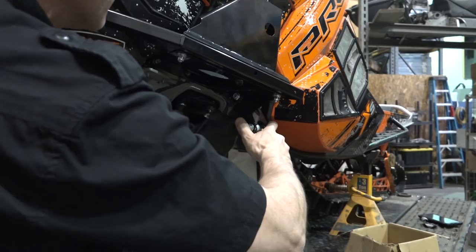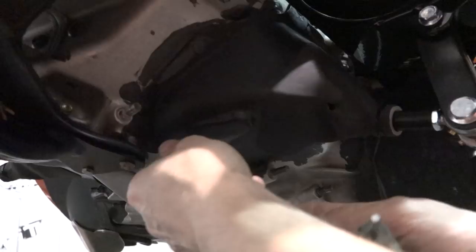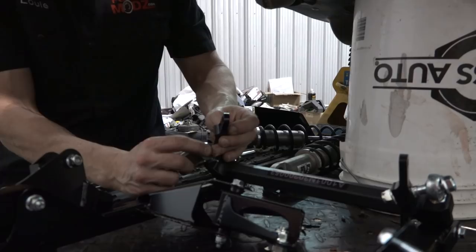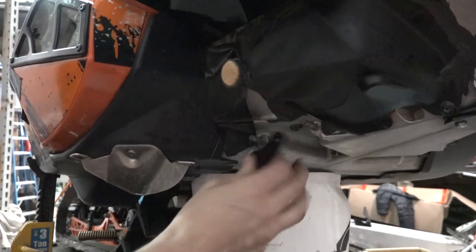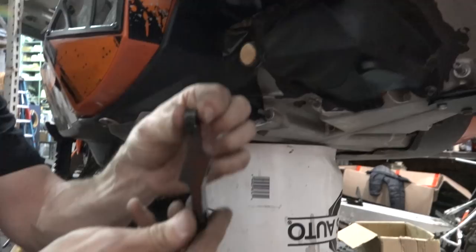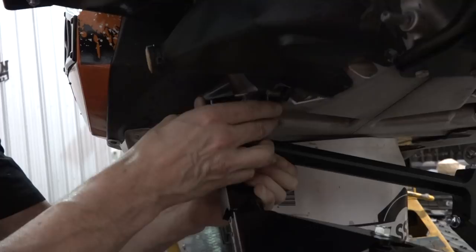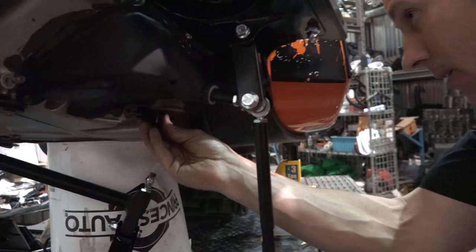That moves freely. That's done up. Now we can buckle this baby up right here. There we go. We'll pop these babies out, but when you're doing this, just watch this little spacer thing here. Don't lose that. And these go on like that, and the reason is the bulkhead on the sled is tapered on an angle, and this takes that angle out, makes it go in there straight. I'll do the same with the other side. Just gonna push that there and lightly put this in. I'm just loosely putting all this stuff into place. See where that one went wrong. Gotta go like this.